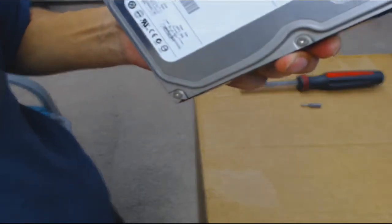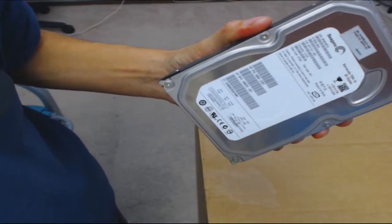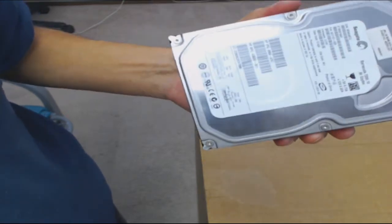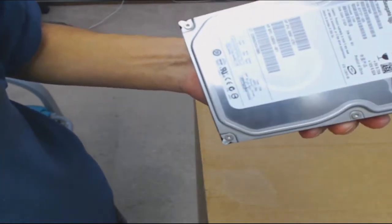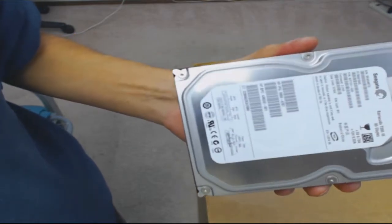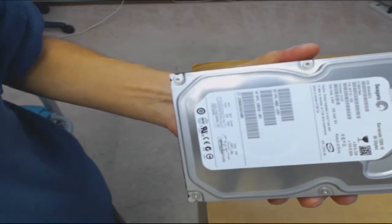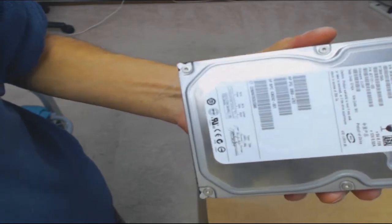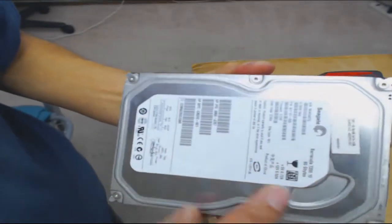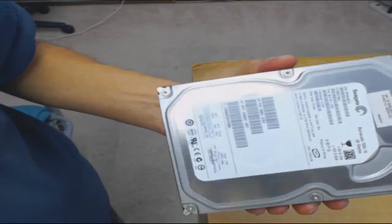I've had Windows 10 loaded on this drive for about a year and a half. About every six months I have to run Check Disk because Windows 10 just stops booting properly. This last time I could not fix my issue with Check Disk, then I tried to run DBAN and it failed pretty quickly. I didn't even waste my time running a diagnostic test, because if a drive doesn't boot properly and you try to wipe it and it fails, a lot of times it's a failing hard drive. Diagnostic tests take a long time, but they are recommended.